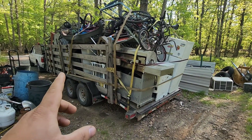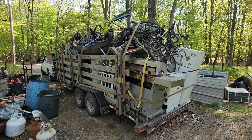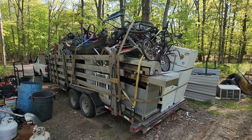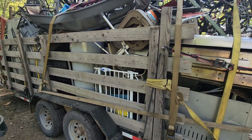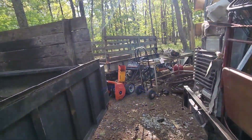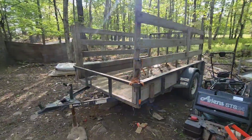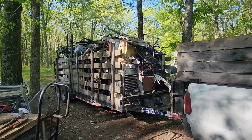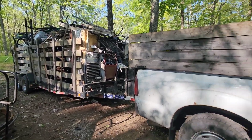If you have a car trailer and you put a 3,000-pound car on it, that's 6,000 pounds — you need an F-150 or higher to tow that. You could probably tow it with a Toyota Tundra or new Ford Ranger, but you'd be at the max. A Honda Ridgeline is not gonna tow it — you'll be maxed out on tongue weight, which forces you to push the car back and makes the trailer too tail-heavy. Those trucks are made for small trailers. Most standard F-150 EcoBoosts have high ratings, but once the load is high and catches air, they don't tow well.